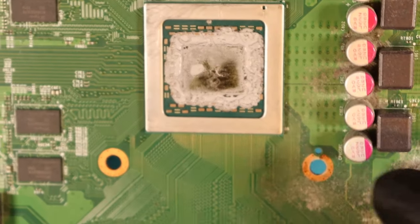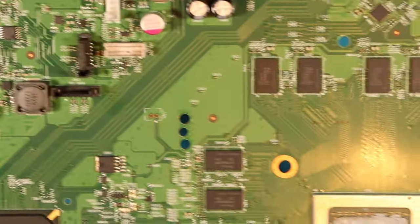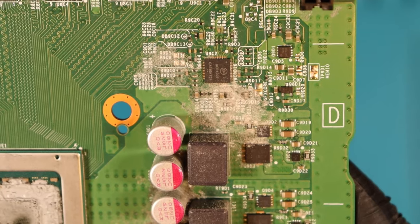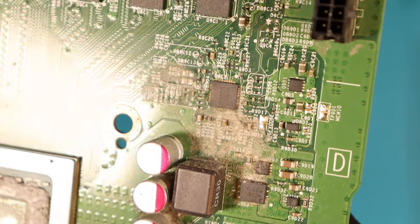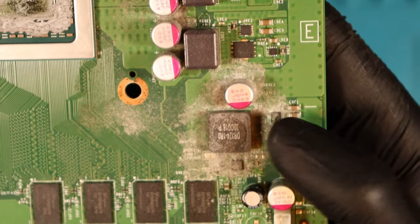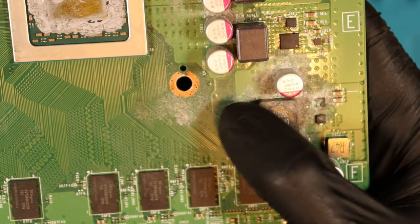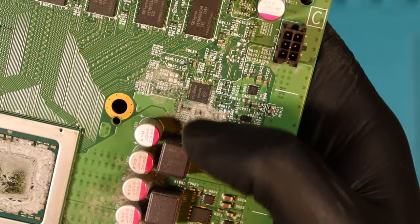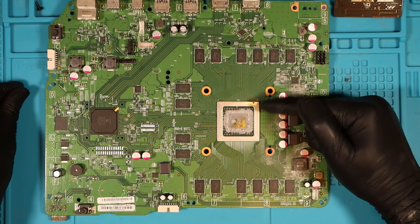Now I've been to clean this out and the first thing I'll say is there's almost like a greasy thing on the die in the center here. The rest of the board is okay. Dust came off very very easily except for this area here — if the dust is all sticky it's probably some sort of liquid damage. And this area down here just wasn't coming off at all. There's a tad bit of corrosion on this little chip here. From looking at these areas it's very clear that I need to clean this up further with some IPA, a toothbrush and a cotton bud. I think we can say the issue is around here. First off let's get rid of the thermal compound that's on the CPU.